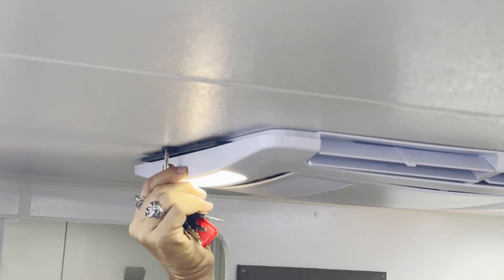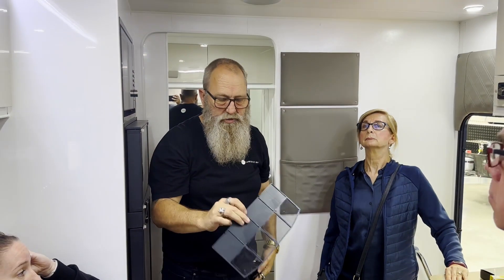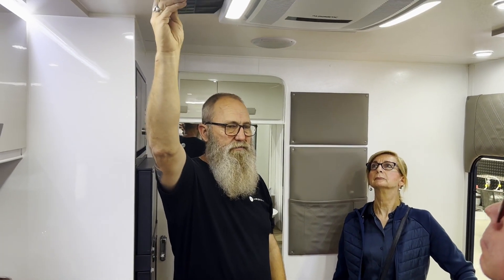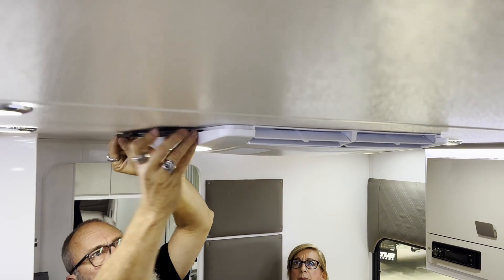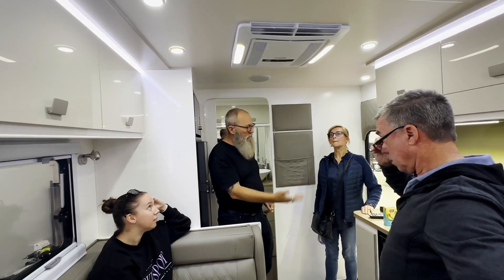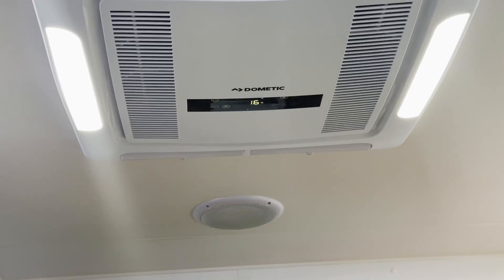The air con intakes are in here and it's got pre-filters — little tabs you can pull out to clean. Do this on a regular basis: if using the van a lot, once a week; adjust based on usage. To get the filter out, slide it far enough to pull free — it's a little mesh. Give it warm soapy water to clean. Make sure you put it back the correct way with the little tab facing down. Getting it back in is a fun challenge — there's a piece of plastic on the roof with a skinny slot. Pull the cover down slightly to line up the hole first, bring it back square, then slide it in.